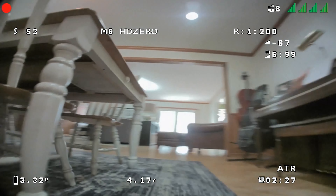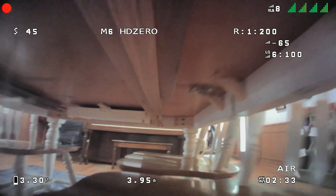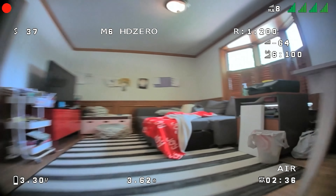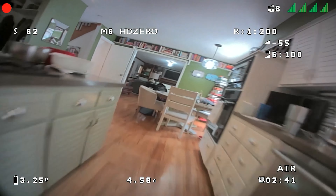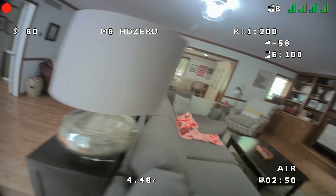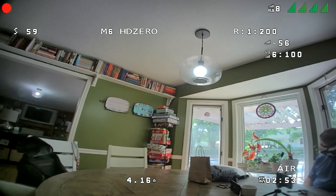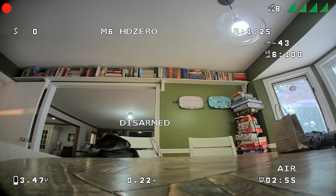I do think they went with bi-blades on this primarily to hit the flight time goal. I'm noticing more and more quads are basing their battery recommendation and seemingly choosing components based on a three-minute flight time — that's me speculating, but I think that's probably where we're at. In my case I would probably go tri-blades. We're going to bring it into land here, and we can see the battery voltage came in right about exactly where you want it. Two minutes, 55 seconds of mixed-bag flying, battery at 3.51V.